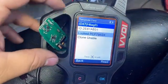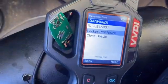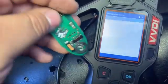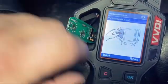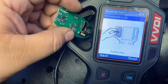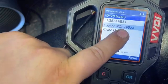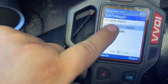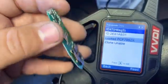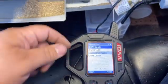If you buy a used key online, you cannot program it to a vehicle. Every used key has been previously programmed to a vehicle, and once programmed, the transponder chip automatically locks up. This is a used key and the chip is locked. In order to unlock this chip we need to renew the remote — that's the only way to reprogram these used keys to a vehicle.